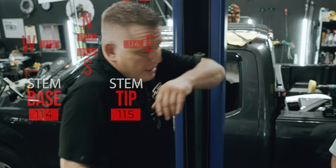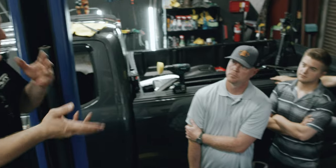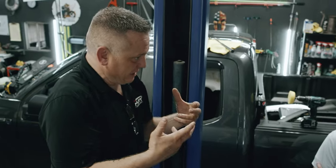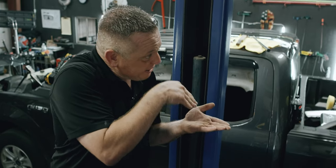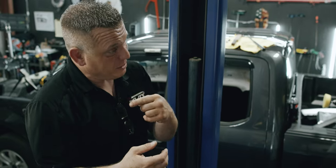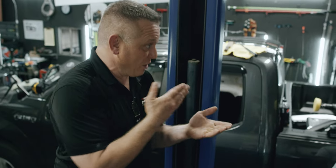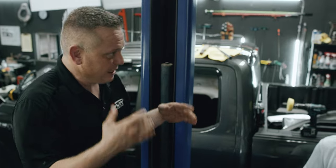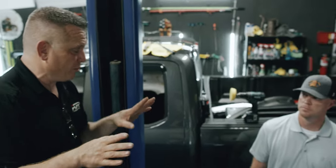Here's why I'm doing this. So a lot of times you hear, get it down to 80 degrees, ish. The cure rate needs to be all the same, because a lot of times you'll have molten where you can't see it, right? Which is why I check the face and the stem, okay? And on bigger tabs, not smaller, smaller tabs you need to be within a half a degree to a degree. That way, in all those data points, you know that you have a consistent cure rate. If you have a bigger tab, if you're not within 2 to 3 degrees in every data point, don't pull.